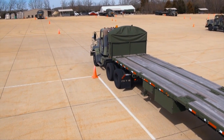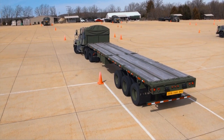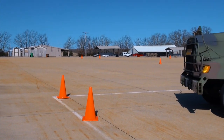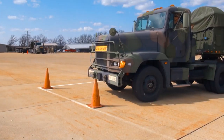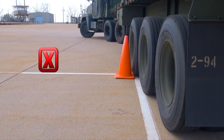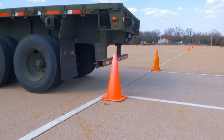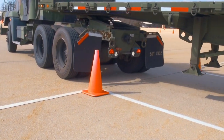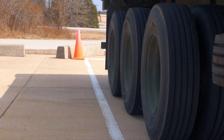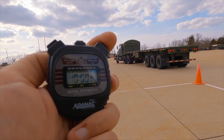Comfort is key in being successful during this task. The standard is simple. The 10-minute time allowance begins when the vehicle is in motion. Pull forward to the cone on the far left of the backing lane, ensuring your position so you do not hit the cone — it should be on the driver's side of the truck next to the bumper. Always honk the city horn twice, or the air horn once if the city horn doesn't work, before beginning to back up. You cannot drive on any boundary lines. No part of the truck can contact a cone, and no safety violations can be conducted as judged by your instructor. The time ends when the entire truck and trailer are in the alley dock lane and you pull the park brakes. The rear bumper must be inside the stop box area and you must not exceed the 10-minute time standard.